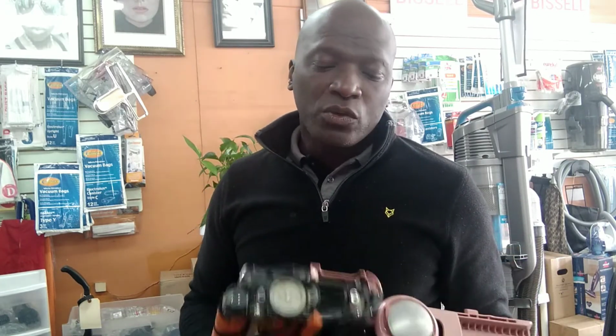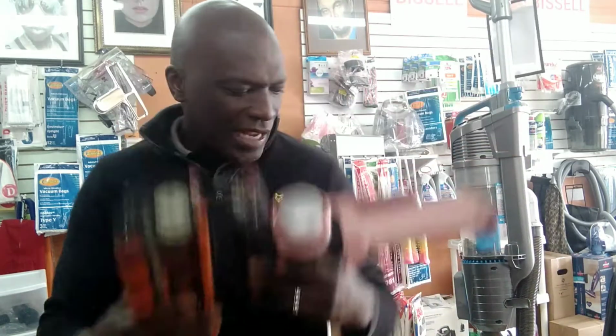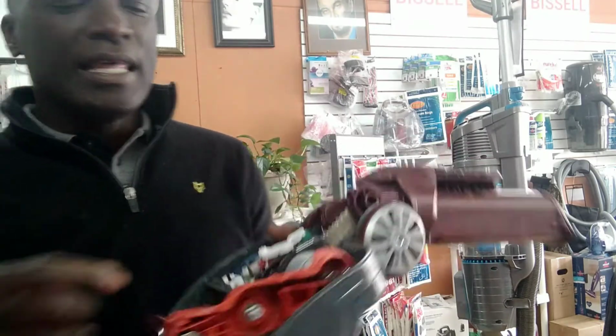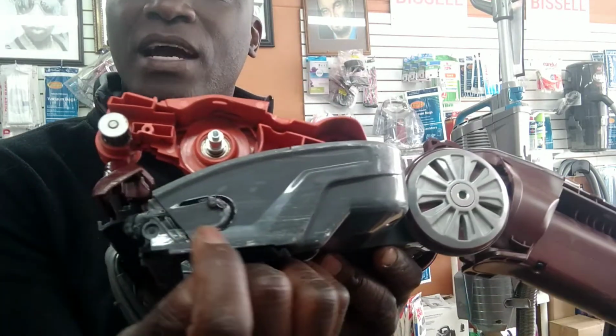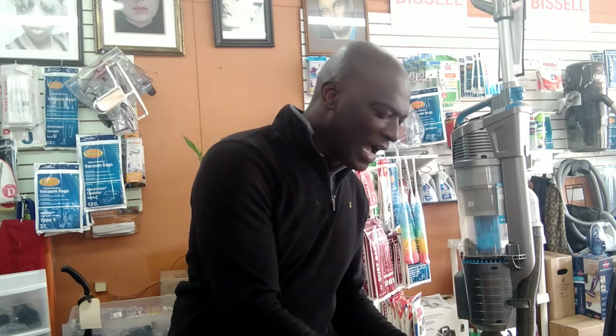Because what you don't want to do is beat yourself up because now not just your belt's broken, but now you broke something else that can't really be replaced, like some of the plastics in the case. So that's something to be aware of for that person who's asking me about that motor, about the Shark. And here's another one. For this one, the gear got messed up, and you can see how the belt started to eat away at this here. So some of these things, man, it's not worth messing around with because of what it's going to put you through mentally.